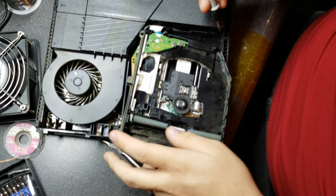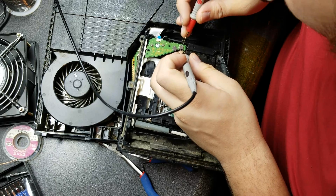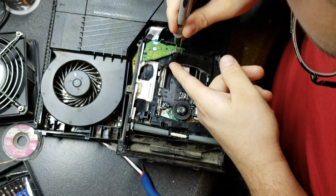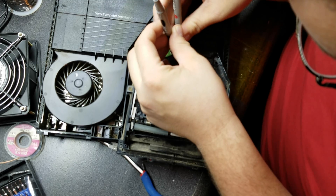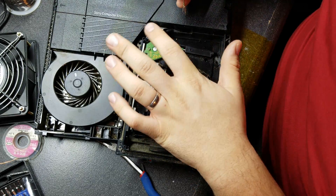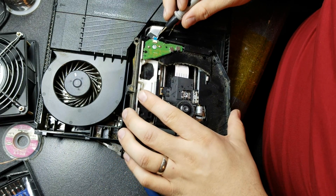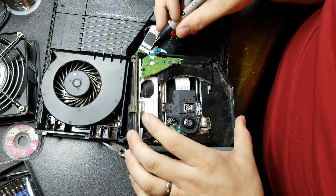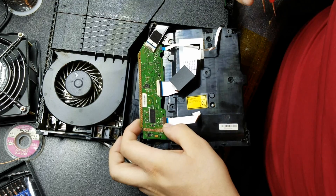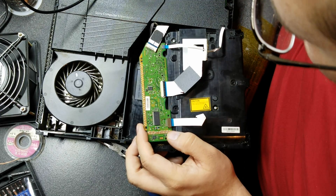So we're going to diagnose this and go down the line to see what is actually happening. I've got the meter in continuity mode. Our switch is working. I already looked at the motor and the motor is completely spinning freely, so the motor's probably not the problem. This switch is not the problem. I did test the ribbon cable off camera before as well — the ribbon cable was actually fine. So let's look at our daughter board, look under the microscope, and check one of the fuses to see if we can find one that's bad.